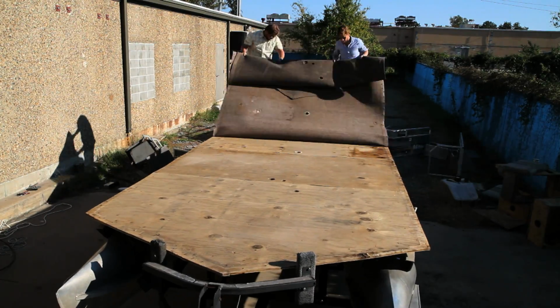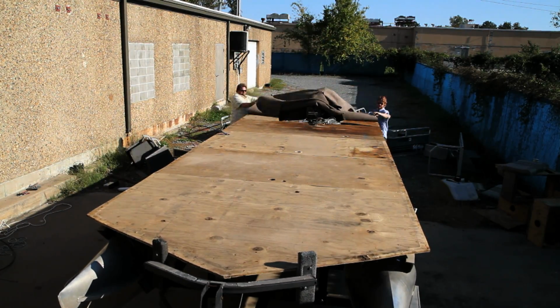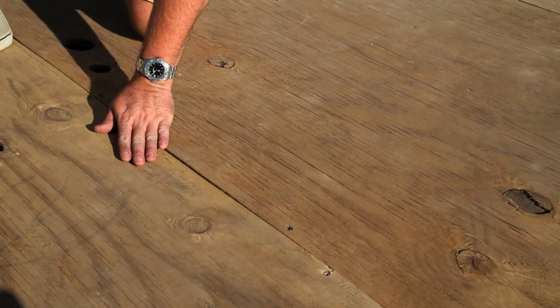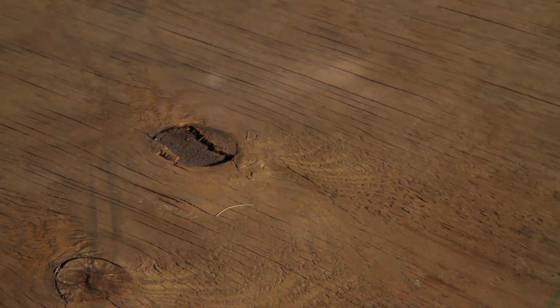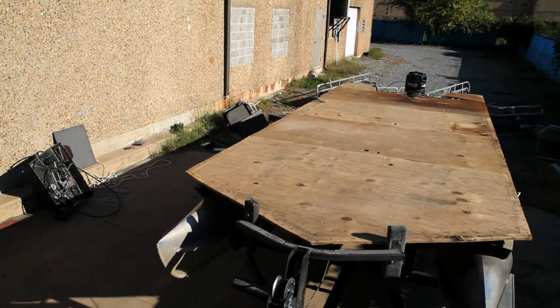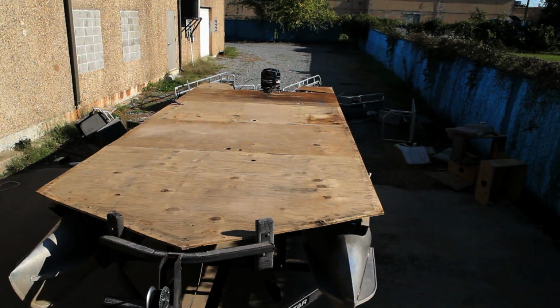Once the decking is exposed, determine if the existing decking is in good enough condition for reuse. Most pontoons are made using marine or pressure-treated plywood. Look for plywood deterioration, holes, and delamination. Also check for carpet adhesive that remains on the existing plywood. Excessive amounts of adhesive may require scraping or sanding to be removed. Any prominent imperfection in the existing plywood could telegraph through the new Marideck. In most cases, replacing the existing plywood is required.